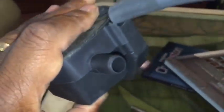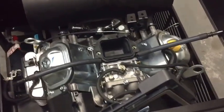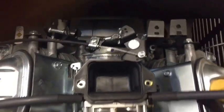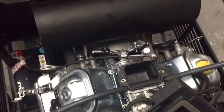I have the carburetor back together. The snorkel is between the air filter housing and the carburetor — no gaps, nice tight fit. At this point I'll put the choke bracket back on, put the air cleaner back on, and get everything back together. Then we'll start it up on gas just to make sure everything's working right. I still want to run it for another several hours before actually running on propane. At that point, we'll get the propane hooked up and tune it for propane.